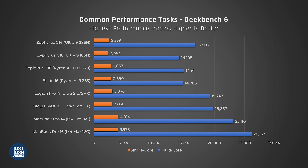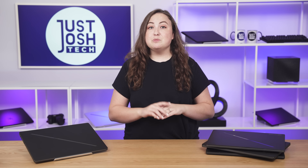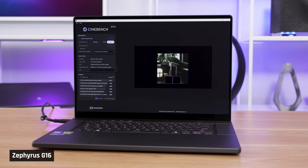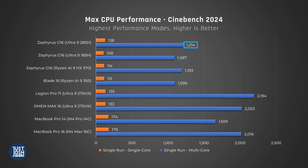Now let's look at CPU performance. In Geekbench, we see about a 10% jump in single-core and 18% jump in multi-core. The Arrow Lake HX chip in larger gaming laptops is much faster, as is Apple's highest-end M4 Max chip — these chips blow the others out of the water. In Cinebench, which tests the processor when pushed to its max, the gap narrows between Intel's Arrow Lake H and AMD's Zen 5. In single-core, Intel has the win. Compared to Arrow Lake HX found in much larger gaming laptops, they perform nearly twice as fast.